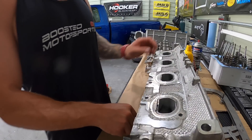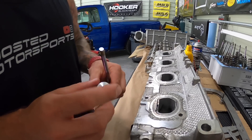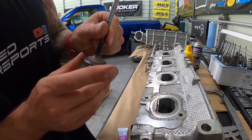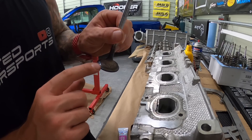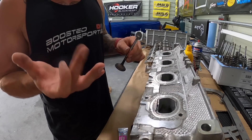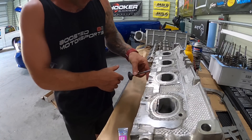We're putting a little bit of oil on the actual valve stem since we're going to be spinning it — just so it's lubricated. Then we take a very light paste of the compound and apply it to the actual face of the valve — nothing too wild.